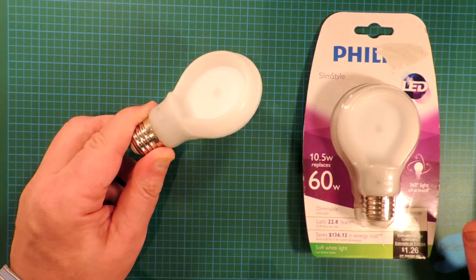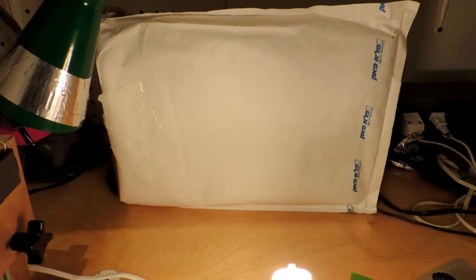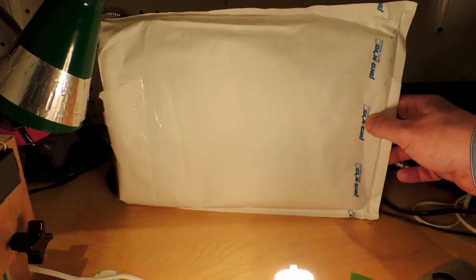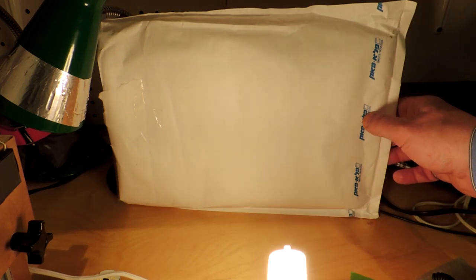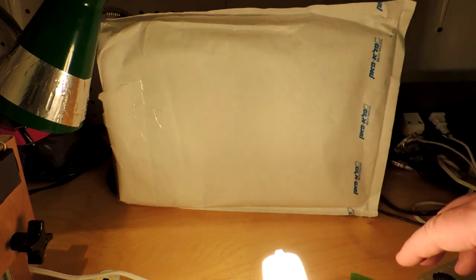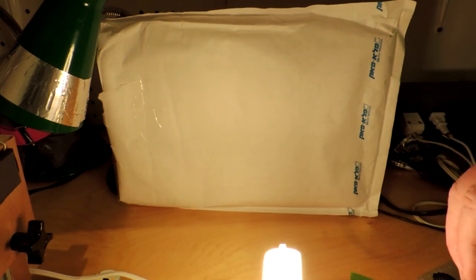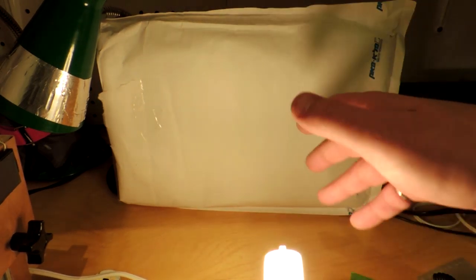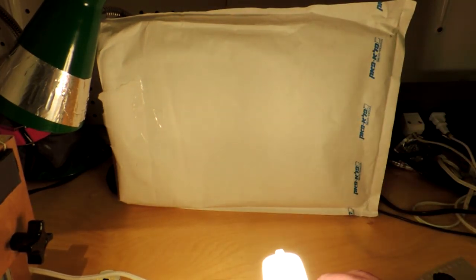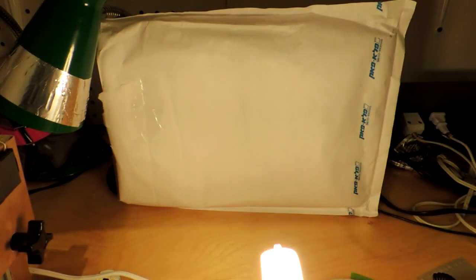This is actually a fairly surprising offering from Philips. The real disappointment of this bulb is that it has a very poor light pattern. On the edge here, I'll just move the bulbs back and forth a little bit. You can see on this white piece of paper there's a significant dark band. If you check other people's reports on the internet on a lampshade, you can see a dark stripe — completely unacceptable. I can't imagine why anyone, other than maybe utility lighting, would accept having a dark band on their bulbs. Let's do a polar plot and just confirm this.